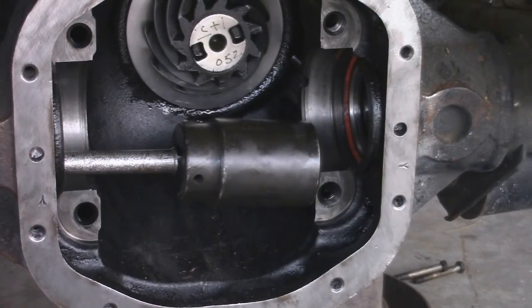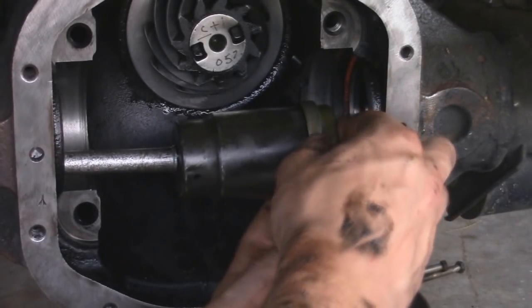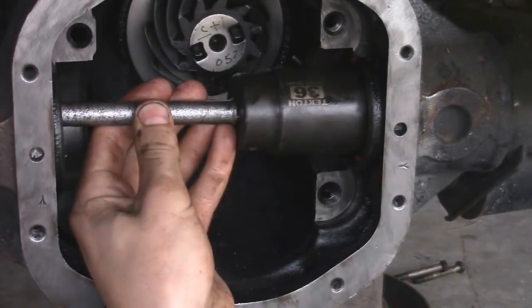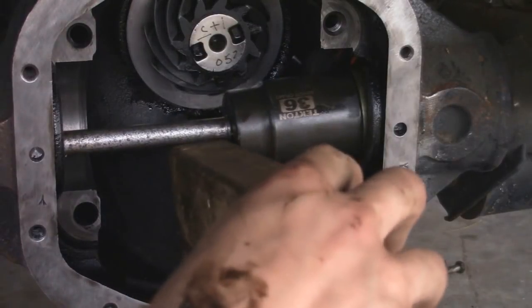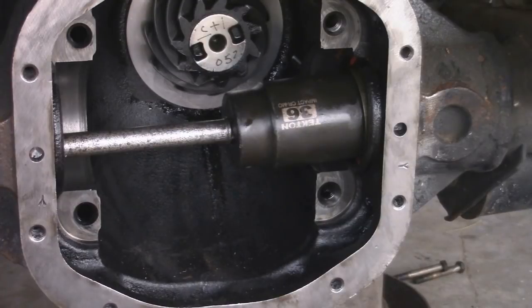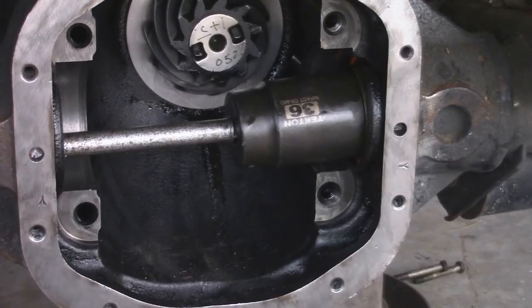The best way I found for putting these in is to take the old seal — it actually fits into the 36mm socket better than the new seals for some reason. So I put the old seal there, the new seal fits perfectly behind it, and I just hammered from there with the 36mm socket. If it's not holding up straight, I took a 2x4 and wedged it in, then just hammered straight in. It seemed to go in without any problems that way. That's the best way to do it if you're by yourself. If you have two people, obviously it would be a lot easier because someone could just hold it in without it slipping.